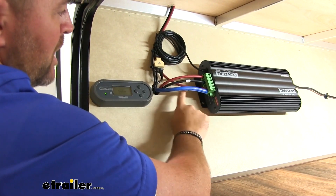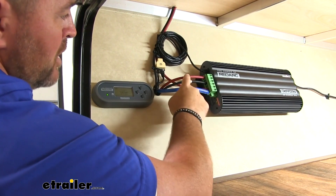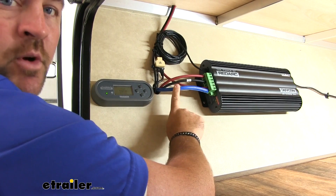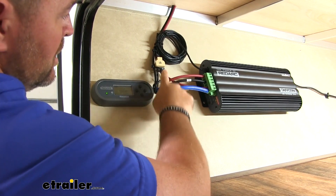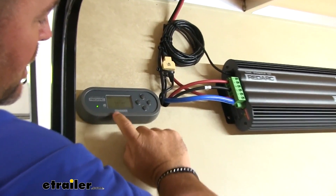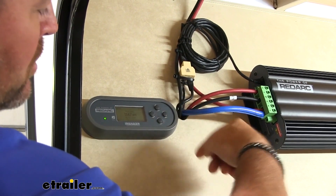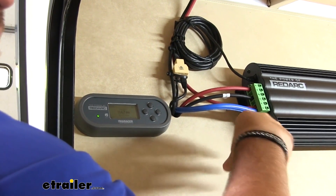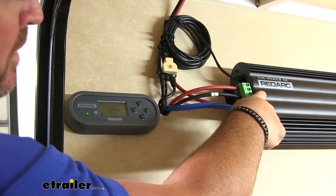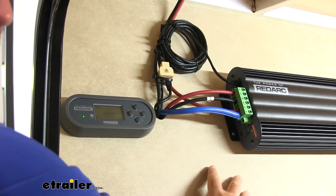We're going to have our power wire from our solar panel going into the unit. We're going to have power and ground coming out of the unit that goes outside. We're going to have our DC power coming from our vehicle. This little box here gets our information and has a cord that comes off the back of our screen, runs into the box. We have a battery sensor mounted outside by our batteries that plugs in and runs into our unit. The unit allows us to tie all of this together to help maintain the charge on our batteries.